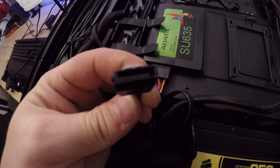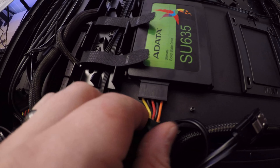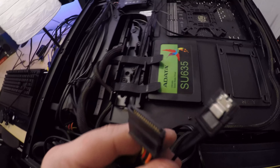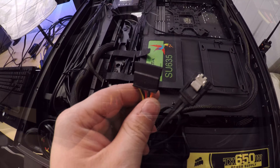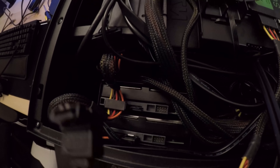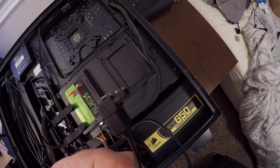This gives us a plan for what we need to do to hook up our new SSD. We don't want to hook it up to the same power and SATA port as this one, but we can take a power cord and a SATA cable from a different drive — one that isn't as important as the boot drive. So I'm going to take the SATA cable from one of my hard drives. I have one empty hard drive, so it doesn't matter — you don't need it to boot. I took that SATA cable and I'm going to plug it into my new SSD.